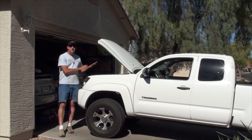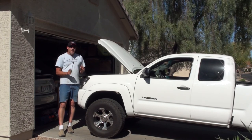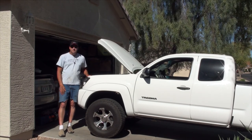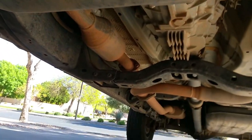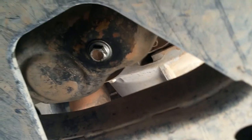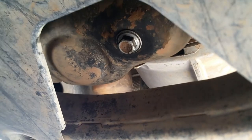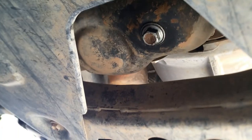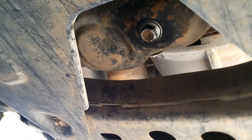Let's get under the truck. One thing I love about this truck is how user-friendly it is to work on. I'm under the truck right now and you don't even need a jack to get under it at factory ride height. They left a cutout in the factory skid plate so you can get to the oil drain pan. The drain plug is vertical, so you don't have to worry about oil coming out at a goofy angle as the oil level gets low — just put the pan right under the hole. It's a 14 millimeter bolt.